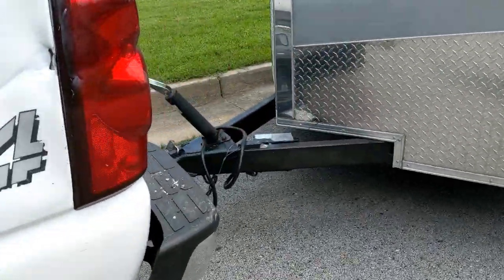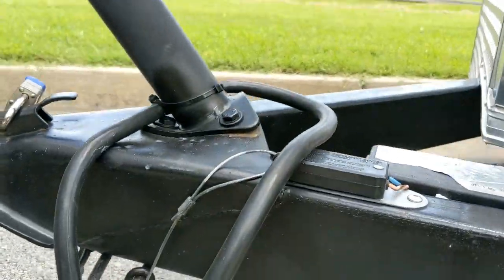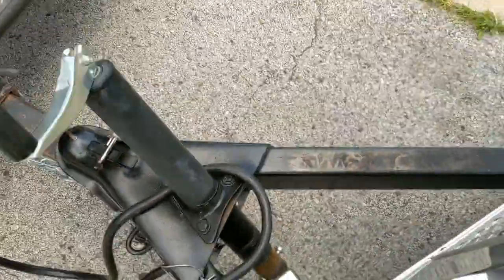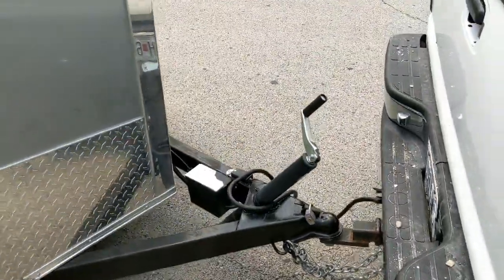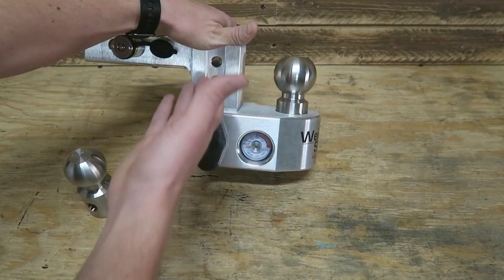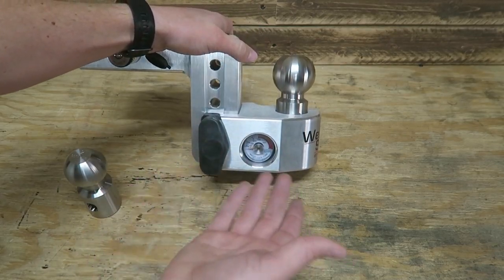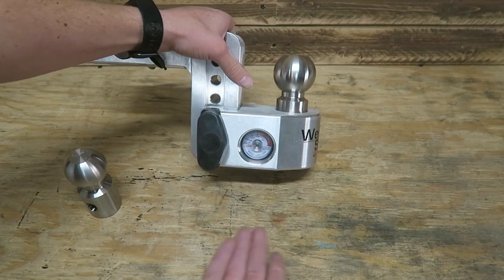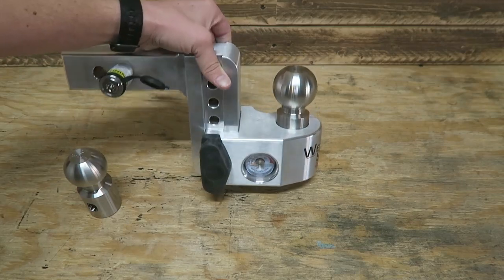The reason I didn't go with the 180-degree option — if you've seen my railroad track video, I took out the trailer jack on my trailer going over some railroad tracks because it hung down too far. Having a ball that hangs down even further is just something I don't want. I've got a long wheelbase truck and the distance between the rear wheels and the middle is further than most trucks, so that low point becomes even lower going into a dip. Same reason I didn't go with a deeper hitch — I only really need a four inch drop now and I'd rather have as tight a clearance as possible to make everything more streamlined going down the road.